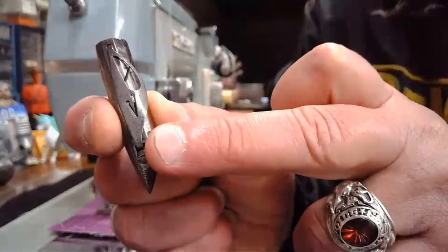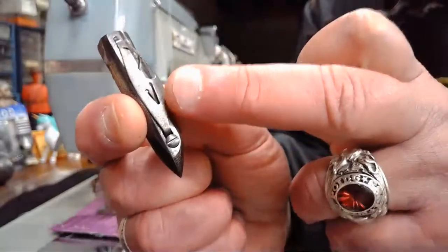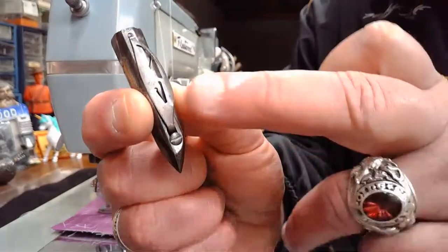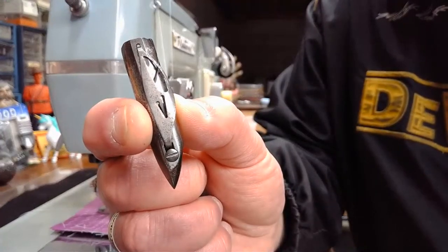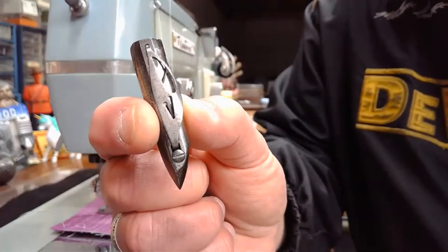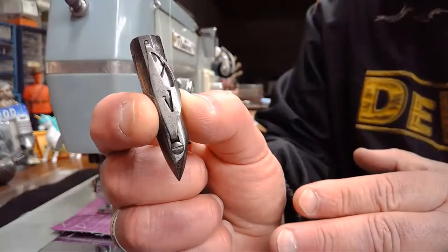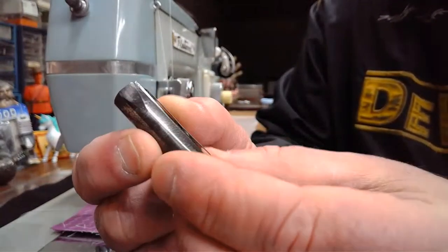The clearance underneath this is so tight, the way this vibrating shuttle is made, that trying to get a size 138 or a size 207 thread to feed out of here correctly would be really, really difficult. As a matter of fact, this is a real thin gauge metal right here, you might even damage it. So the heaviest thread that I would go on something like this is probably about a size 69. A size 69 would be comparable to what, in most sewing places with an upholstery thread selection, is generally a size 69 thread. So I would not try running anything heavier than that in this.